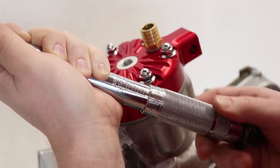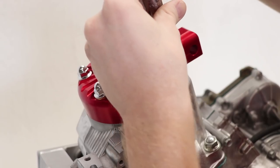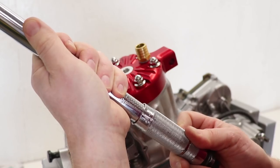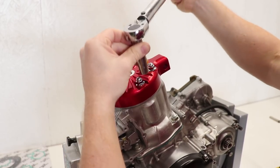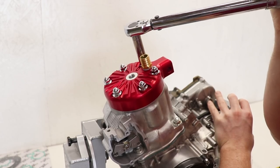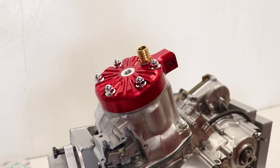It's very important that the head nuts get torqued in an even pattern. The torque spec for this head is 20 foot-pounds. First I'm tightening all of these to 10 foot-pounds in a crisscross pattern — much like tightening a wheel on a car. Now bumping up to 15 foot-pounds following the same pattern, and then up to 20. Boom — just like that the motor is now finished up. Such a good feeling. Always a good idea to pop in the spark plug just to keep anything from entering the engine.